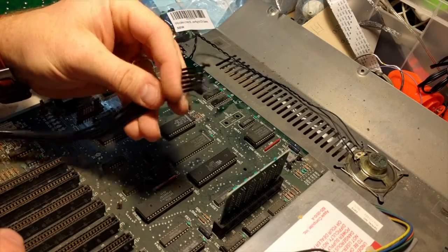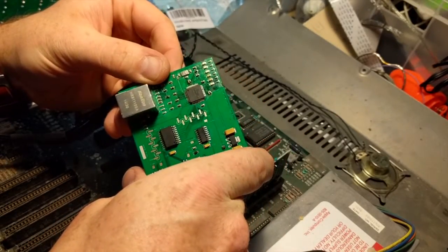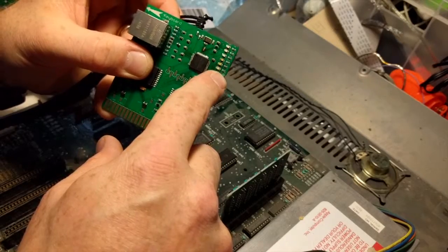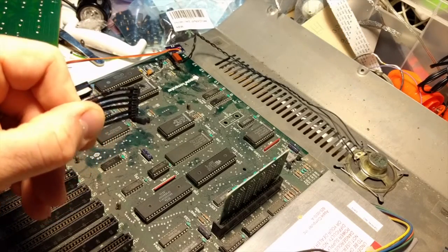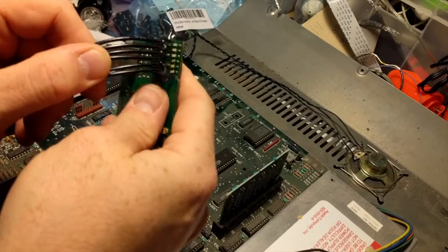With the port cover secured, now you just work with this end and your UtherNet card. The top corner of the UtherNet is where the LEDs reside. If you look at the end of the light pipe with the fiber optics facing you, you should have an L-shape there, and that will go over the LEDs on the UtherNet card.